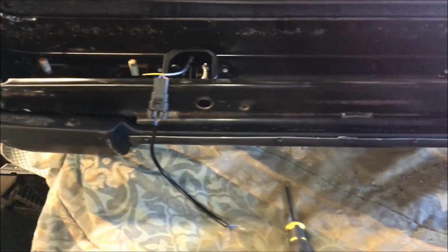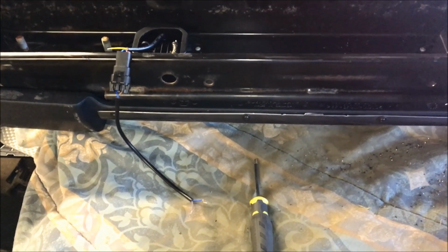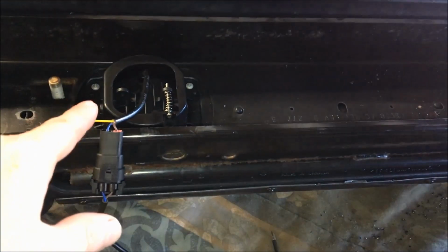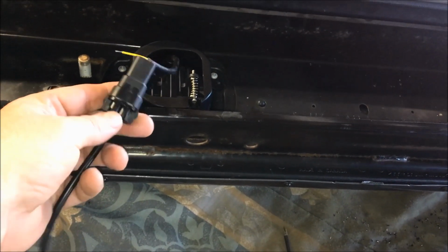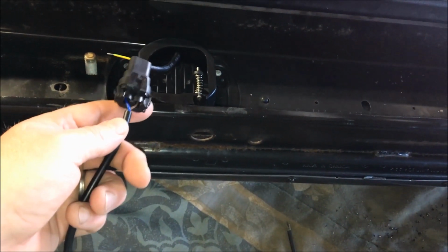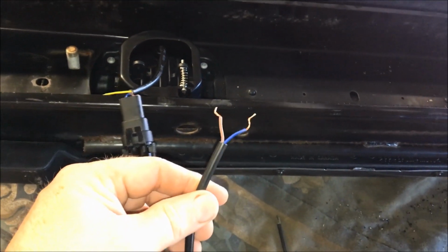Right, so now we're going to talk about the wiring of the fog lights. So probably this is going to be the biggest challenge as far as wiring for the install of this kit, because for whatever reason, even though this fog light is designed to fit the bumper of the Jeep, they did not include the proper type of connection as far as the body style that would correspond with the connector on the Jeep. So they gave you this pigtail, which you have to splice in.